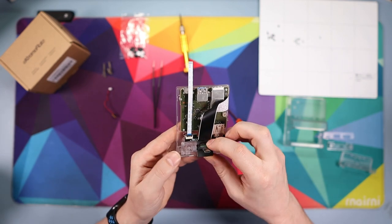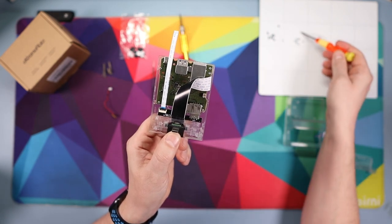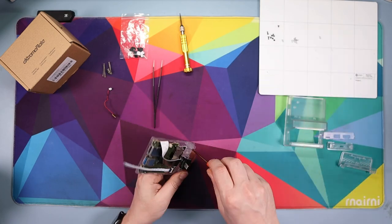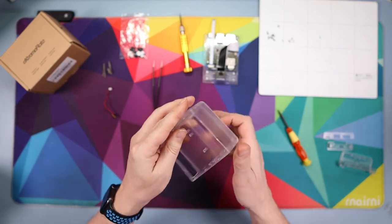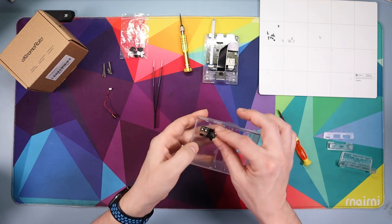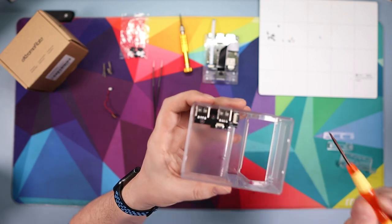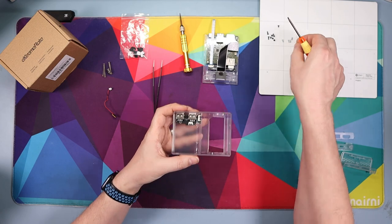With the cable coming out towards you, place this assembly down and make sure the cable spins around and feeds underneath and up through into place. Once it's seated, put in four screws — I'm using four of the silver screws from the set of nine we took out earlier. Then grab the main dock shell piece; where the two USB holes are, place the other USB module on — it rests on three pins inside. Then put three more screws in to secure it.